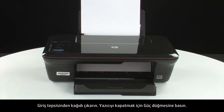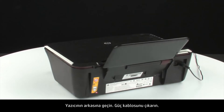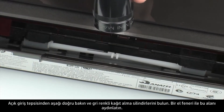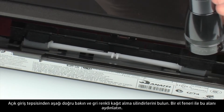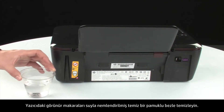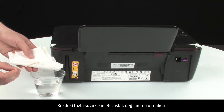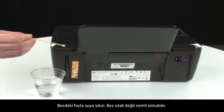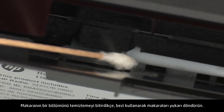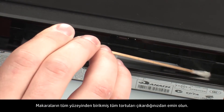Remove the paper from the input tray. Press the power button to turn off the printer. Turn to the back of the printer and disconnect the power cord. Look down through the open input tray and find the gray paper pick rollers. Use a flashlight to illuminate the area. Clean the rollers with a clean cotton swab lightly moistened with water. Remove excess water from the swab by blotting it on a cloth — the swab should be damp but not soaking wet. Wipe each roller starting on the right side and wiping to the left, using the swab to turn the rollers up as you finish cleaning each section. Make sure to remove any buildup or debris from the entire surface of the rollers.